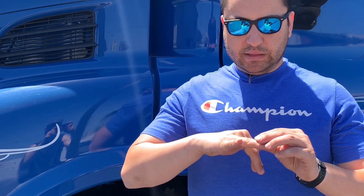I've been having issues with the EGR Delta pressure sensors. I was in the Corpus Christi area, which is extremely humid, and it was a very warm day. The check engine event came on and triggered the EGR Delta pressure sensor fault, which causes a 25% reduction in power — which is a lot if you have a full load of cars on the trailer and you're trying to climb a hill. We're used to driving this truck in the high desert, Arizona and Southern California, which doesn't have much humidity.